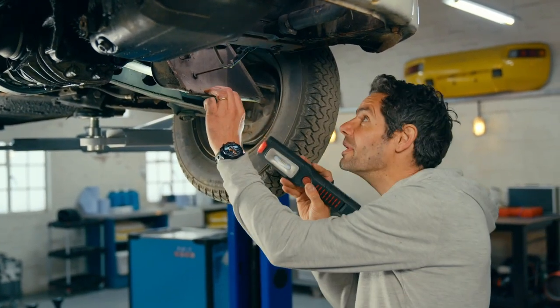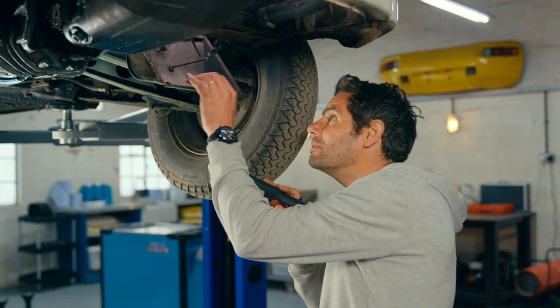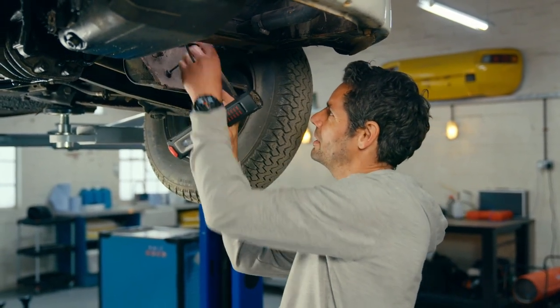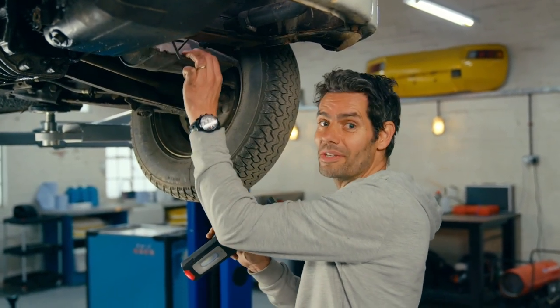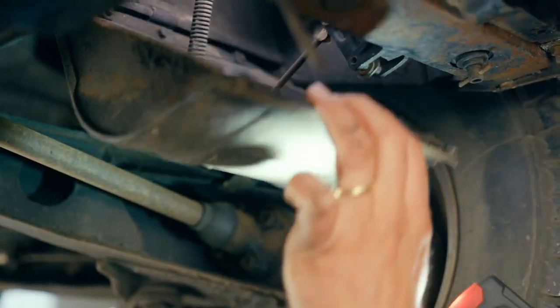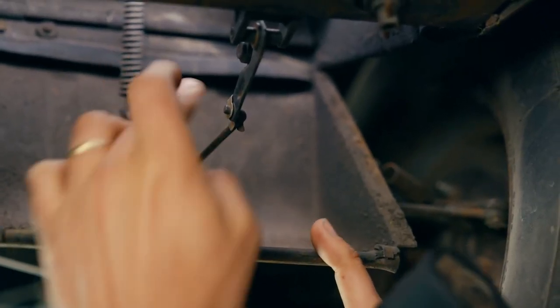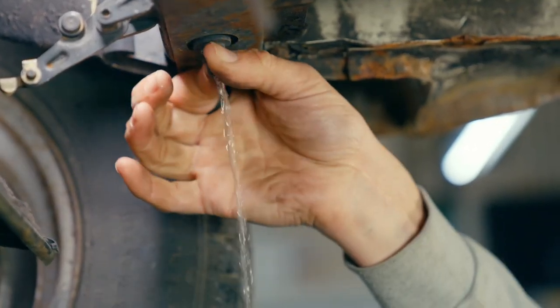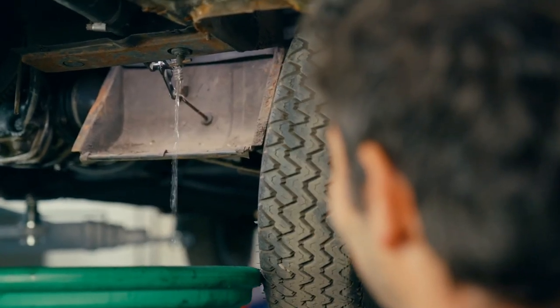Now that the car's up in the air I can get a slightly better look at this unique cooling arrangement on the Fiat 600. This flap here should open and close as the engine rises and lowers in temperature to moderate the cooling, but this mechanical linkage has gone over centre and locked it open, so once I've got the coolant drained out and the engine out of the way I'm going to take a closer look at trying to fix that.